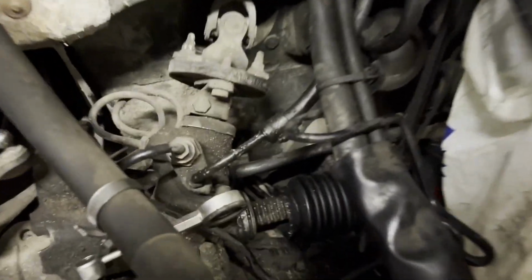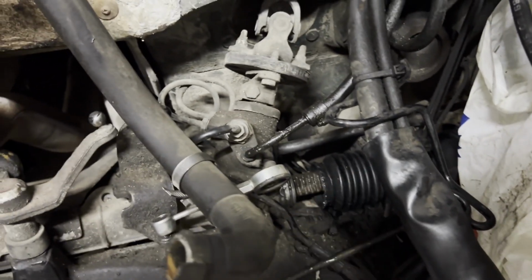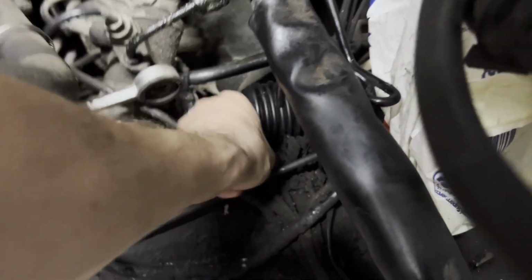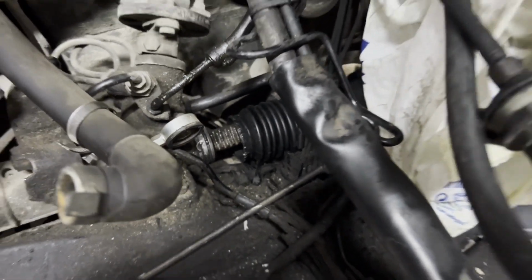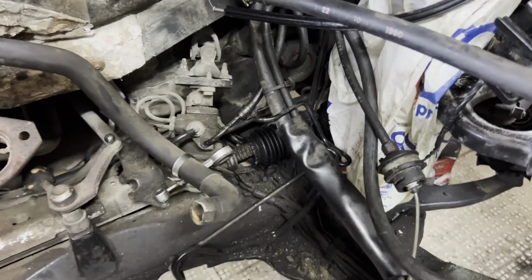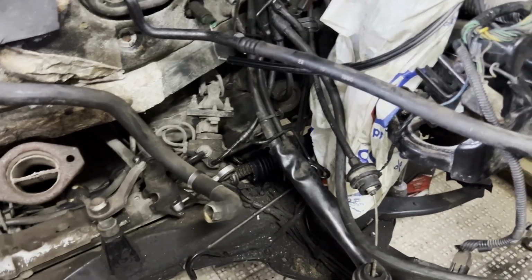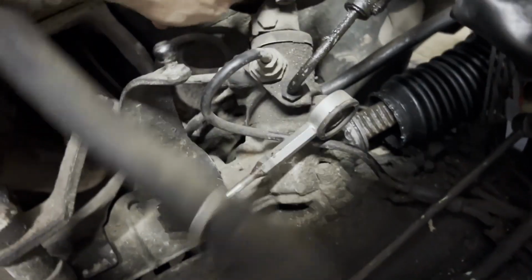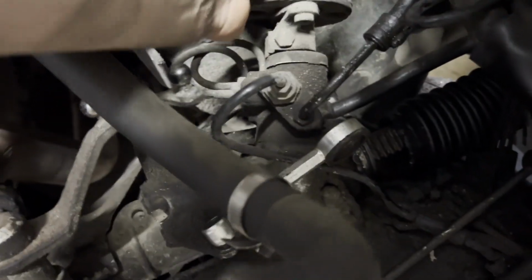You can see that, yeah, that boot was okay until I got to the MOT, and then it got loose. I don't even know where the... Oh yes, it's somewhere here, the zip tie, but not doing much. Access is incredible, really good to try and diagnose our problem with the knock, which I think is this disc, but actually it doesn't look like it's a disc.